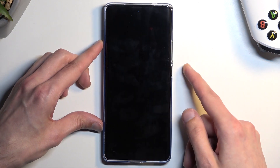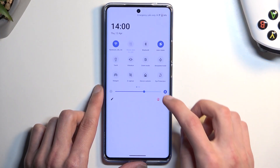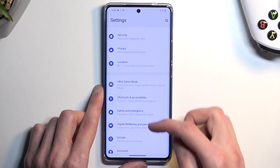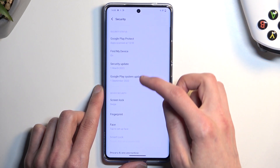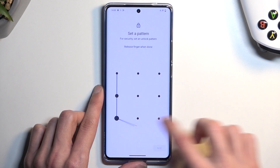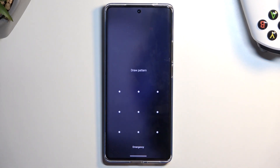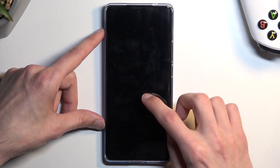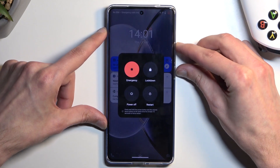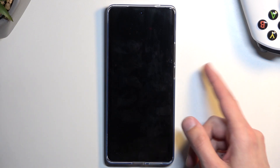Sticking back with this one — I'll lock the device. I don't have a pattern so I'm going to quickly set one up. I'm going to proceed as though I don't know my pattern even though you just saw me create it. To get started, hold the power key and volume up at the same time, then select power off. Once the device turns off, again hold the power key and volume up.